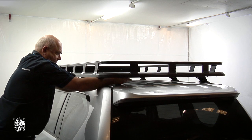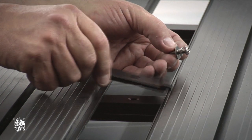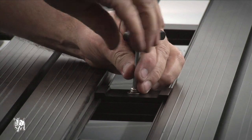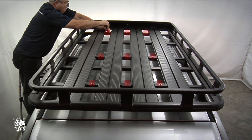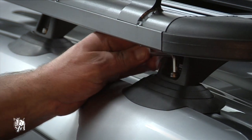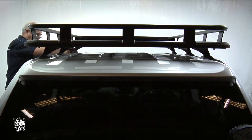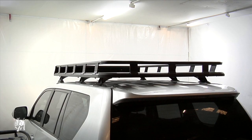Tighten security screws to secure the legs to the vehicle. Recommended tightening torque is 3-4 Nm. Fit locking tabs to secure the planks onto the crossbar. Use the security screw, spring washer, flat washer and fit the locking tabs onto the cage nuts within the crossbar. All locking tabs are required to hold the tray firmly into position. Place the M6 screw washer assembly through the heavy duty leg kit and fasten to the mounting pad using the supplied 5 mm Allen key. The recommended tightening torque is 3-4 Nm. Repeat this process for the other five legs. The Toyota Prado Pioneer Tray is now ready for use. Thank you.